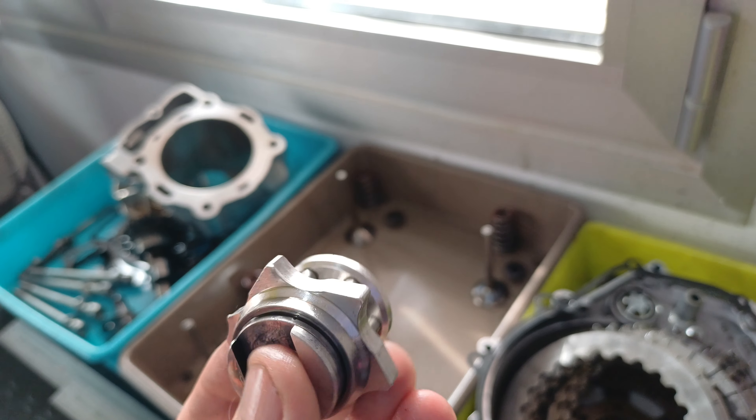The clutch looks pretty good — it always does with the slipper clutch. Now these plastic gears have gone tight and there are a couple of shards of plastic you can see that have come off them, so they need replacing. They were still operating the oil pump alright, so there's no actual immediate problem, but they would have failed eventually — they definitely need replacing for the rebuild.